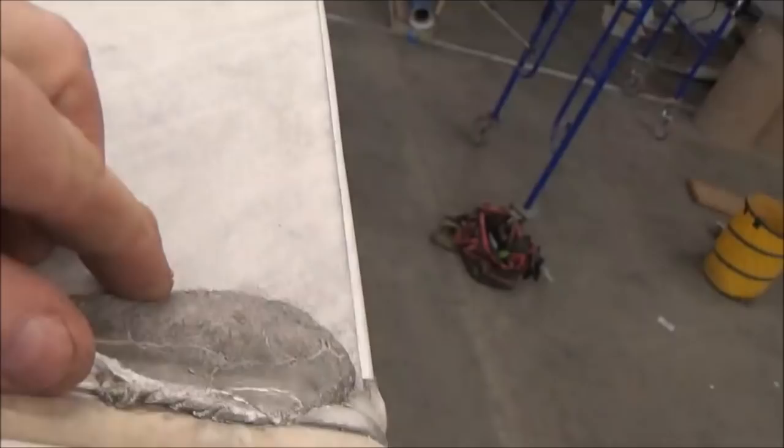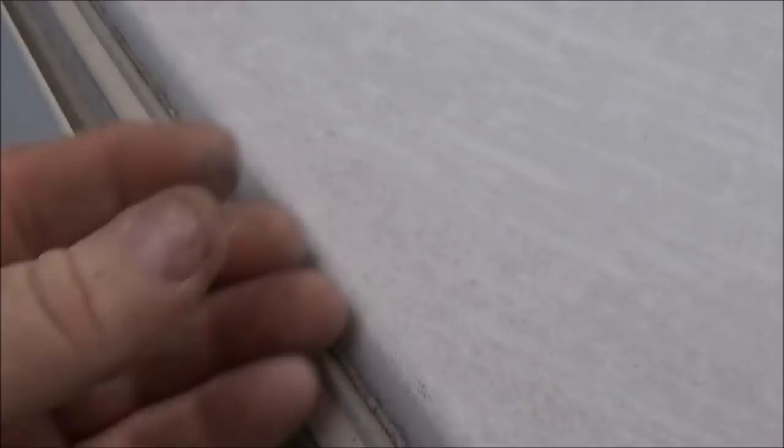Okay, so here's a ladder we just took off right here. A lot of times you'll get this breaching right in here, and that's where the water will come down, right in there. So this may have happened on the back here too. Doesn't look like there's any sealant on there, see? No sealant. That's just butyl. Butyl could be your best friend or your worst enemy. That's all dry. When butyl dries out, it'll suck the water in. That's what it'll do. But they didn't even seal any of this.